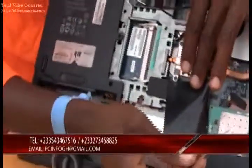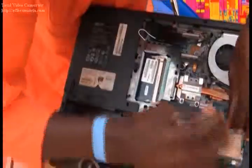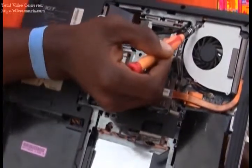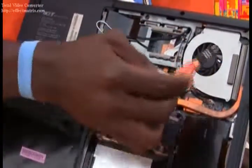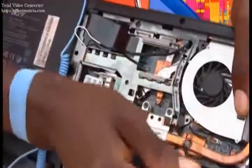Removal of the wireless card — removal of the wireless card. Extremely gradual and easy. You don't really need to add any force. Take it out gradually. Next, now we have to use the two screws — these are the two screws here and here — in order to remove the fan. We disconnect the connector which actually supplies the power that makes this fan functional. You have to dislodge the cable from this connector.